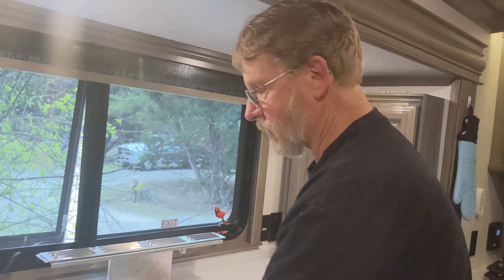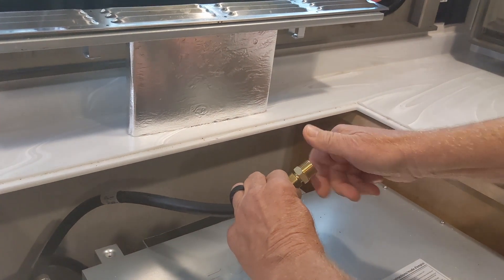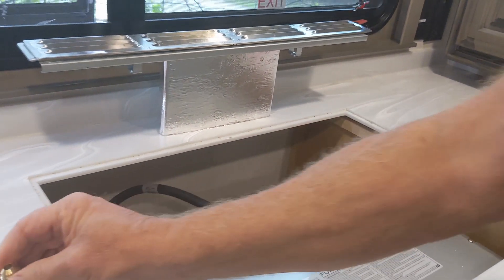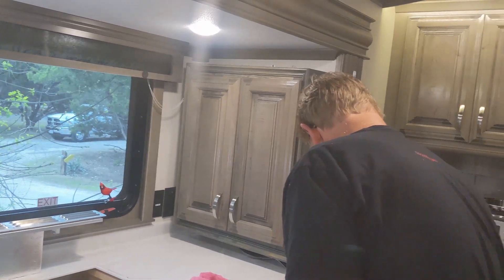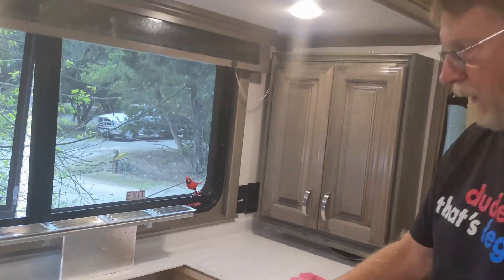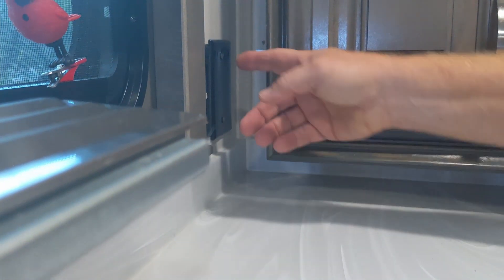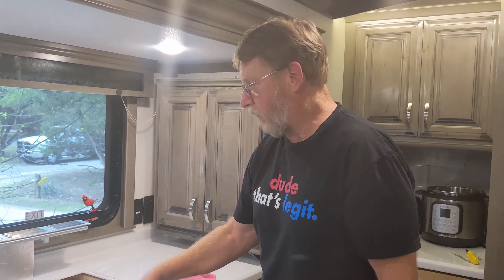I've fitted everything to make sure this gas valve is going to work — this is the new gas valve and it's going to fit the new line perfectly. Did we determine the cooktop did not have any electrical power to it? I don't know how it ignites the old one — it must have a battery or something, because it doesn't have 12 volts. The oven has 12 volts on the igniter, but the cooktop doesn't. The new cooktop does run off AC, so I will cut a small 2-inch hole with a hole saw and come up to this AC power — just plug in underneath so you won't see it. It runs off 120 volts. If we're boondocking and don't have 120 volts, all we've got to do is light it with a lighter, which works fine on it.